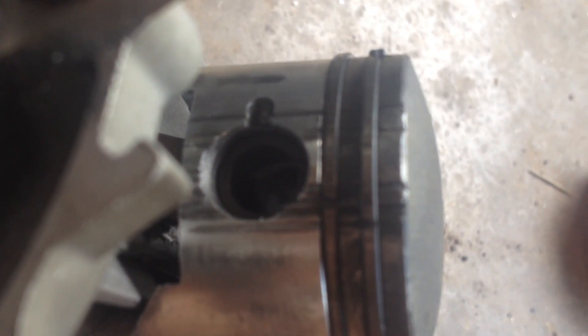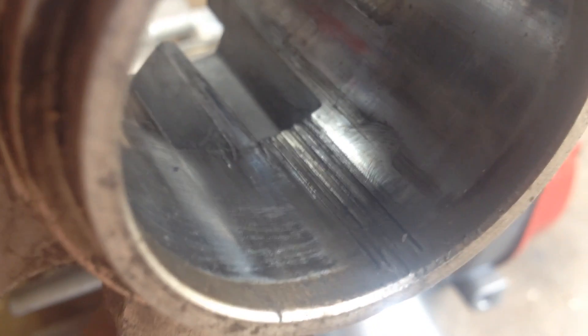They're on both sides — very deep cuts, like shards or whatever they are. With all those cuts in the piston and on the piston head, all that air is gonna get in between those little cuts and it's gonna get out — it's not gonna be compressed. That's what's wrong with this engine. I finally found out what it was.